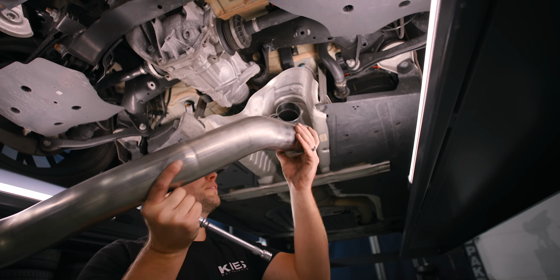Okay, just like that. Now, what you'll notice is that the AWE routing is a little bit different than stock. And if you leave this piece of plastic here, you will melt it. What you're going to need to do is remove the 10s that are over here, and then you got an 8 over here, a couple 8s over here, and then this piece will be out of your life forever. See, and if you do it at this point, it acts as a convenient little holder. So with that, let's remove this, and then I'm going to reinstall my 8 mils over here.